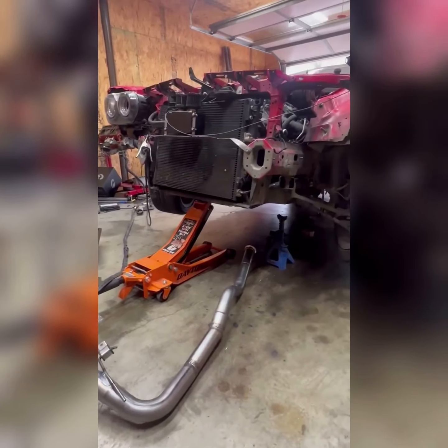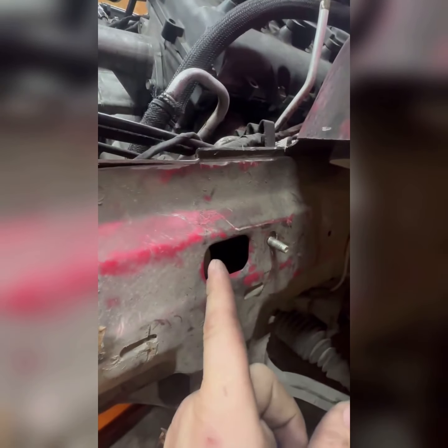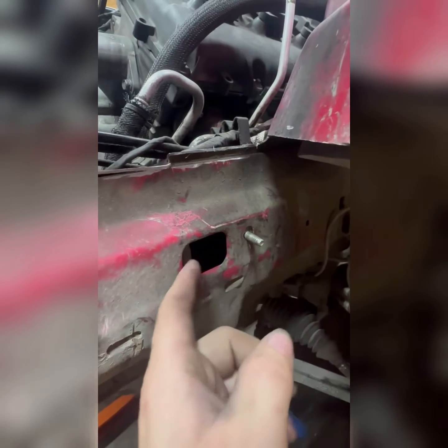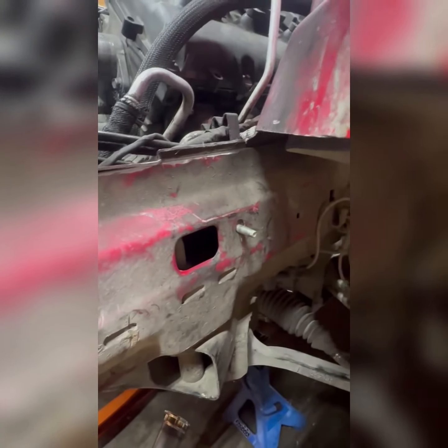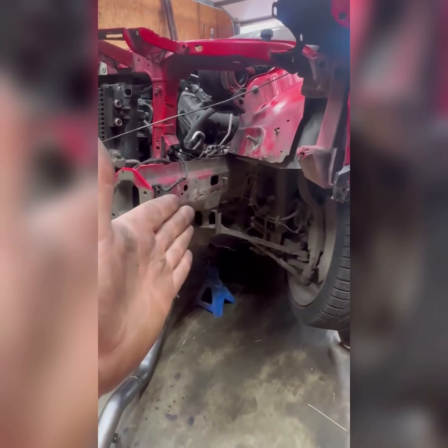After you have your car jacked up and your bumper off, the next thing you want to do is drill out the hole right behind this rectangle. There's already a hole there, it's just this size. So you drill it out for a larger hole. I drilled mine too big, obviously, and you put in my provided bolt for the hot side mount.